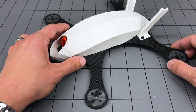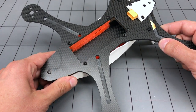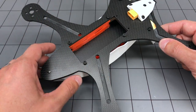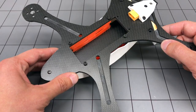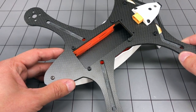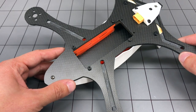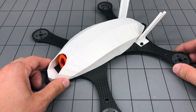The speed controls fit inside, and the battery even fits inside. If we look underneath there's a cavity for the battery to fit inside the frame — it may stick out a little bit, but it's very close to the center of gravity of the machine, lowering the polar moment of inertia and helping performance. The closer we keep things to the center of gravity, the better the performance, allowing the machine to change direction more quickly.